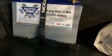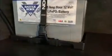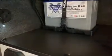So up here in the front of the Pursue is a nice shelf storage area. And what I did is I just drilled a small hole right here, and I ran those battery leads into here, installed this Battleborn up here on the top. I got a battery tray here bolted through to the floor, and then the battery is strapped on, and then the leads off of that. I did make room for a second one, thinking that I might install 2 and run them in parallel.